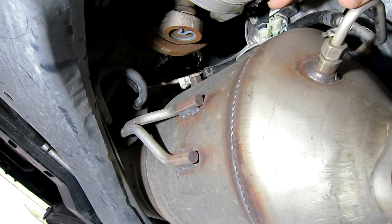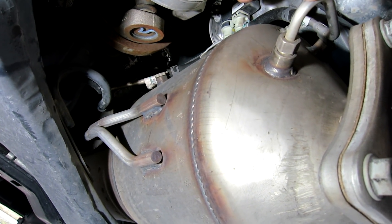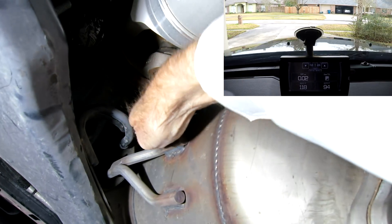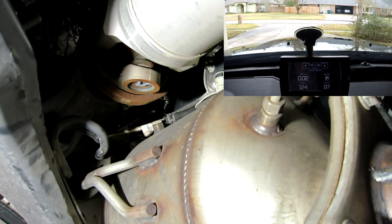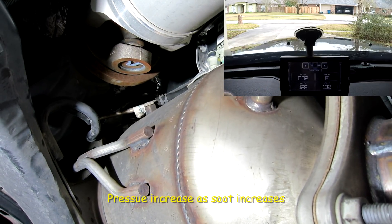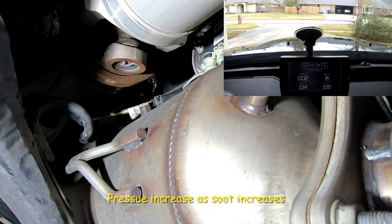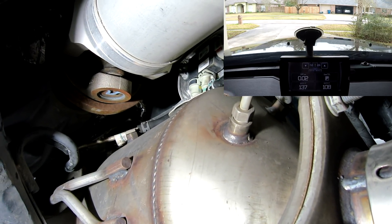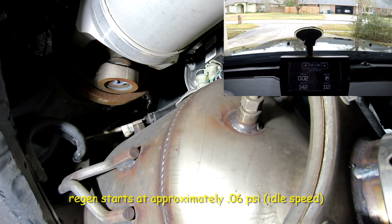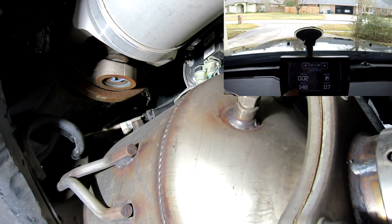You're reading differential pressure — the difference between the pressure on the inlet and the pressure on the outlet. It's a very low pressure; when we were idling it was about 0.02, something like that. That's obviously a very sensitive sensor, and if it went out of whack it probably wouldn't take much to throw things out of kilter. But mine's been working fine, and most people don't have issues with it.